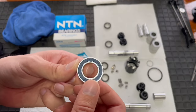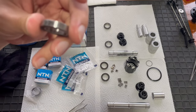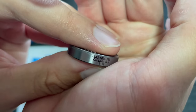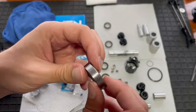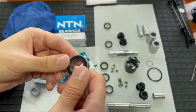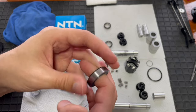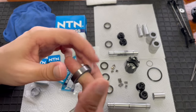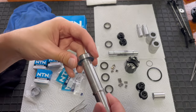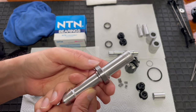Finally, the only bearing in the set that's different from the others - these are all 6803s with ceramic balls, but this one is a 6903 ceramic ball. This is the only one that feels really good with very little wear at all. Possibly its location and size have helped it - it sits all the way at the back of the hub, out of the way of dirt and grime, and it's doing really well.